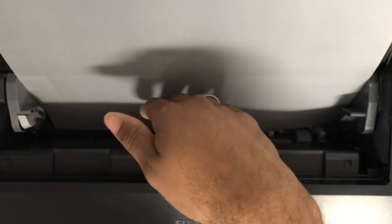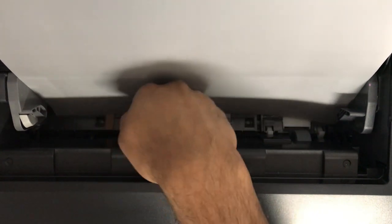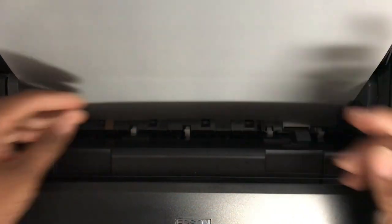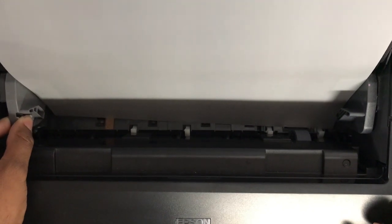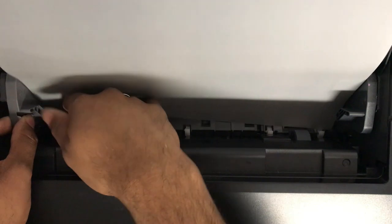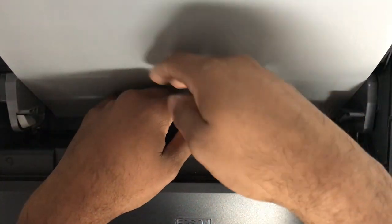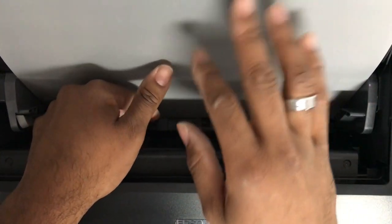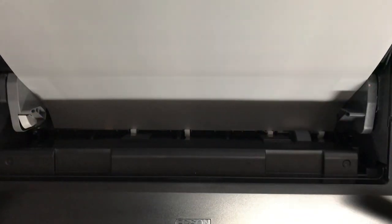So you want to put the sheet in, load one sheet, and press down against the plate and back. That way, you're pressing down and back. And you're also looking at this guide to make sure that it's not causing it to buckle, but it's not too loose either. And you want to keep this flat. If it has a tendency to push forward, put it near a wall, or it may be too close to a wall and you may need to come back, but keep that consistency.